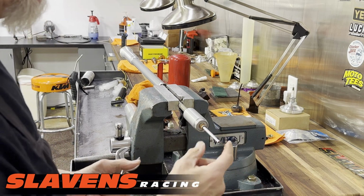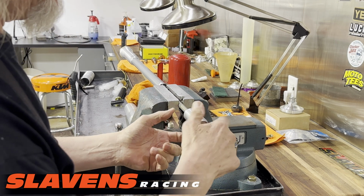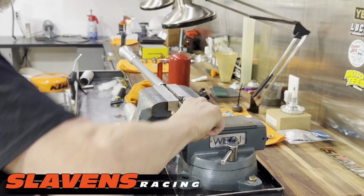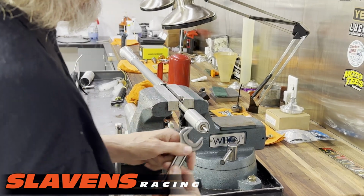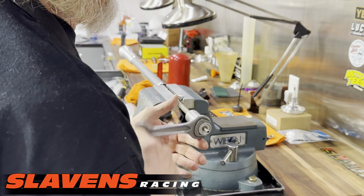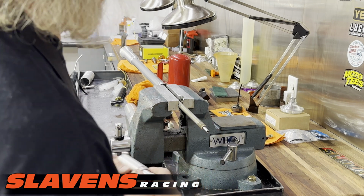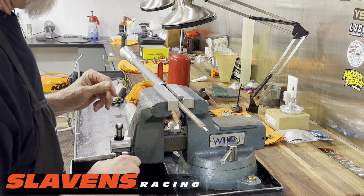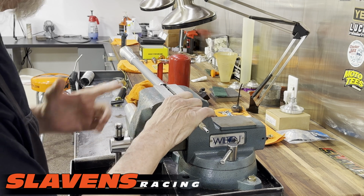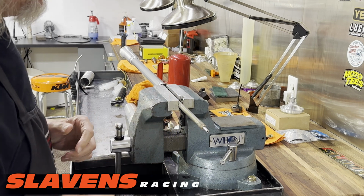There's the rod here. It pushes on the rebound needle. This comes off next. It's going to come off a little bit hard going over the thread locker. Okay, put those two together. And when you're clamping on these spindles, you know, these are stout. You can clamp on these tight, and you really need to, because you don't want this spindle rotating in the vise, because it will take the coating off of it. It will kind of mess it up a little bit.